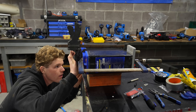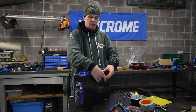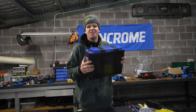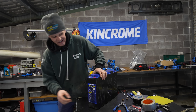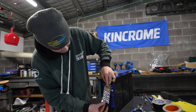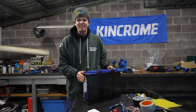The battery's all boxed up — last thing is to let it dry, so we'll come back in 24 hours and we should be right to throw it in the car. The sealant has had a chance to cure overnight, and I've added a strip of cloth tape around the mating surface between the lid and the bottom of the case as an extra layer of protection. With that, the battery is ready. There's no movement inside, it's all well packed — and the best thing is, it's no longer a King's 100 amp hour slimline lithium battery. It is now an Aussie Arvo 105 amp hour slimline lithium battery with waterproof BMS.